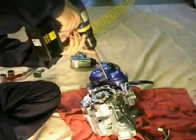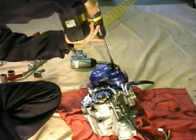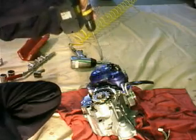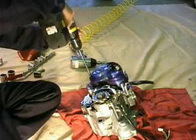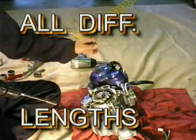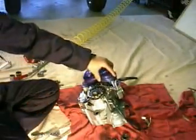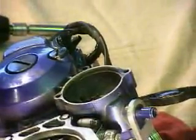There we are. Drill to remove them all — one, two, three, four, five, six, seven, eight. And they're all different lengths, so keep them in order so you know where they come from. Forgot one little one there. Take off the cover — there's nothing in there because we have removed the electric start mechanism, since we have a kickstarter. There are two more bolts you have to get, otherwise the side cover will not come off.